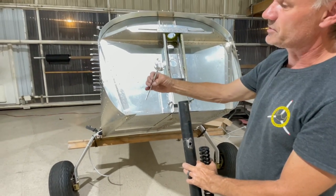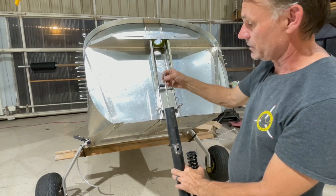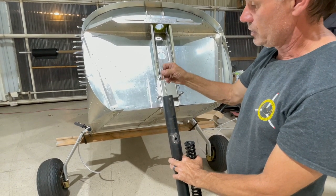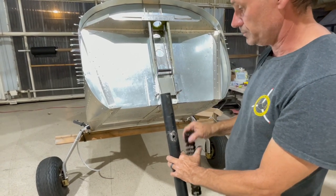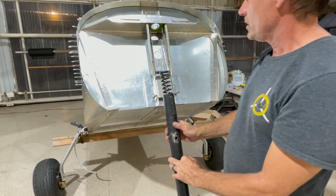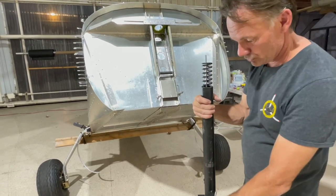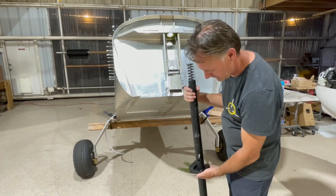This is the bottom saddle — it has a groove in it, and that fits on top of the 5H tube down inside there. Right now it's not on the groove, and I rotate it and it drops onto the groove. Then the spring goes on that, and now we're going to install the gear leg to the fuselage and put these screws back into the belly of the airplane.